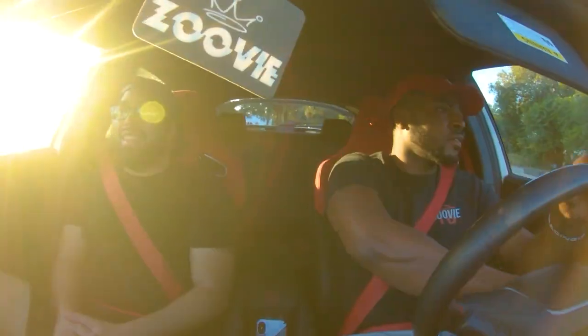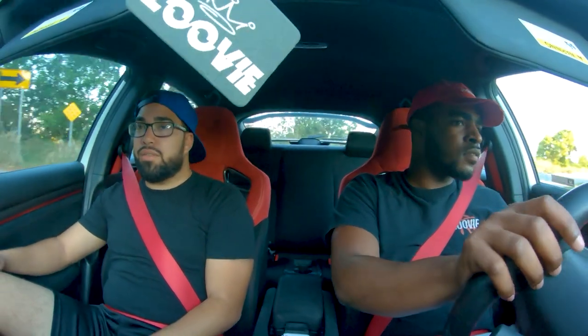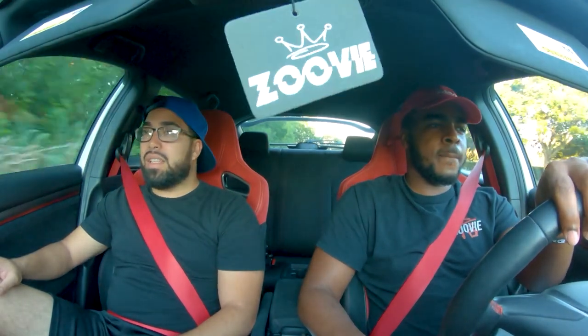The power is way different than on the 9th gen. I would have loved to race the 9th gen at where it was in our first video against this Type R. I think the 9th gen would walk away because it has the extra RPM. As much as I don't want to say it, the 9th gen K-series has the better motor. Internally this motor is great, but people throw rods because it makes too much low-end power. The sleeves on the K20C1 in this car are really thick — the thickest I've ever seen on a stock Honda. People have made 600-700 horsepower on stock sleeves; what gives out are the rods.